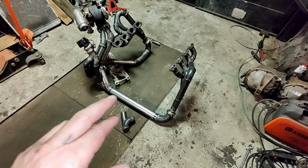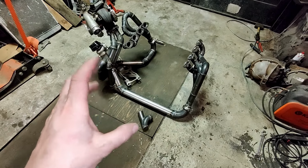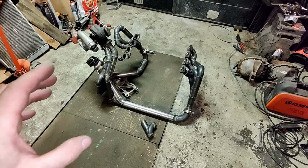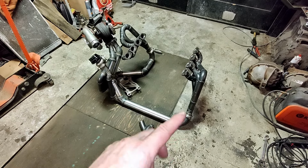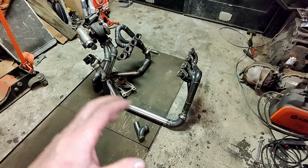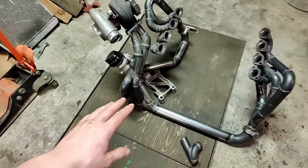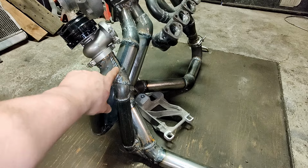And what I did now is that I tuned this exhaust manifold, as well as we could with the space claim, to basically peak torque or close to the turbocharger spool-up area. So I want to help the big turbocharger as much as I can with this setup and these dimensions, and that was the reason for this. And of course the sound thing, but I've considered these topics. And regarding the pulsing, we will also keep the pulses separate from each bank up to the wastegate, so we have a middle wall here.